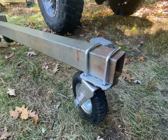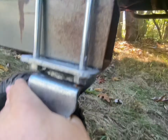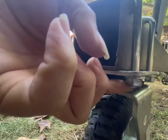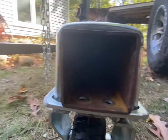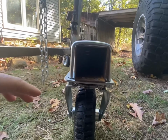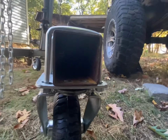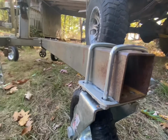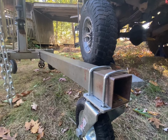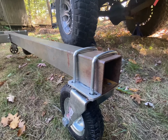I don't know if the hardware setup is different on those 10-inch ones, but on this 8-inch, these come into contact with the U-bolts quite easily, so you gotta make sure they're trimmed nice and flush. I did show that earlier in the video with a caption, but I just wanted to take this time to explain it. Also, be mindful that you don't over crank on these U-bolts where these plates start to bend, because then the bearings kind of will bind up. The plates need to be flat and parallel for those ball bearings to spin around in unison, I guess you could say.